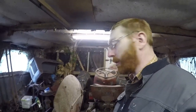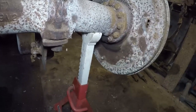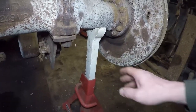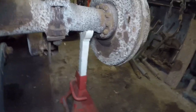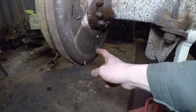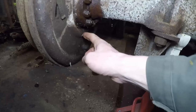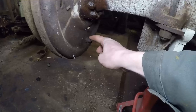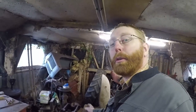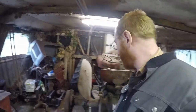We'll take a closer look at what that actually entails. Here we are on the end of the half shaft and as you can see, in very early stages of a leak, the oil is dripping down the brake back plates. When it's really bad it'll be much wetter — everything will be oily — and it'll even run down the wheels when they're on. This one has just started going. The one on the other side is much worse; we've got quite a bit of oil there. As you've probably worked out, if it's leaking down the back of the brake back plates, it's also going to be leaking inside and will have ruined the brake shoes.